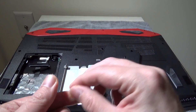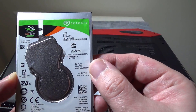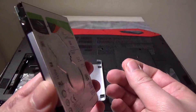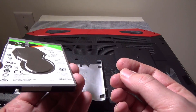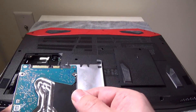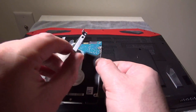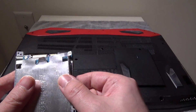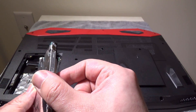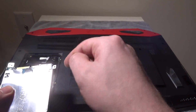You're going to have to get the four screws out of the box. I happen to have a Seagate two terabyte FireCUDA — this is an SSHD drive I use to hold games that people want me to review. That's what we'll be installing today. Of course you're going to want to line this up correctly — you're going to want to have the smaller side of the SATA connection on the right hand side, and then you'll see it just kind of fits over the holes on the sides of the drive.